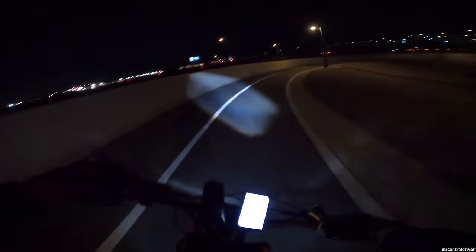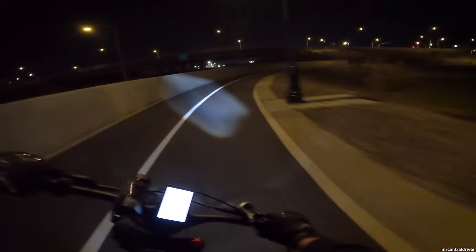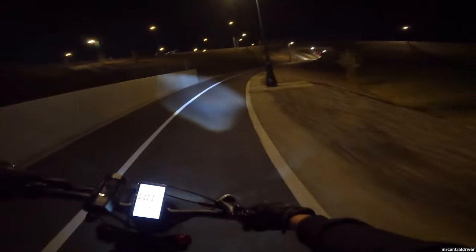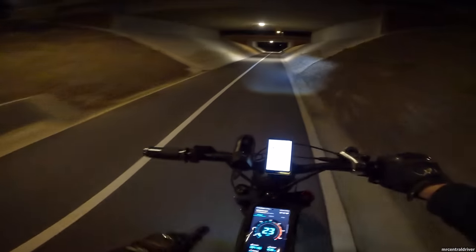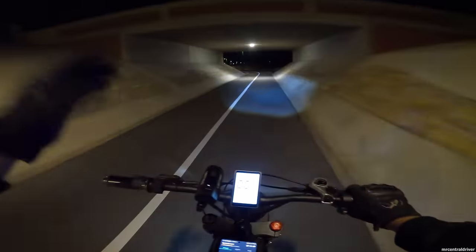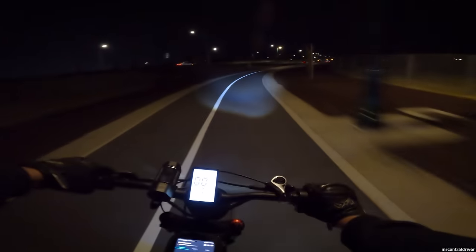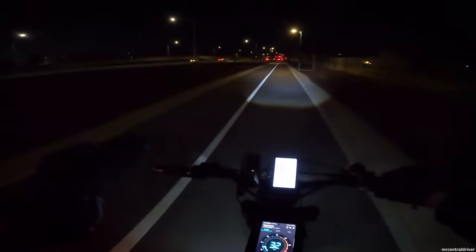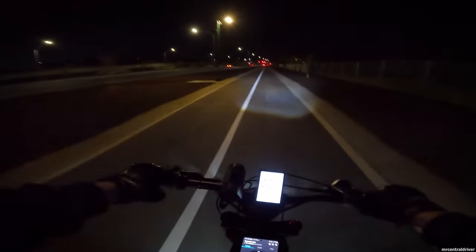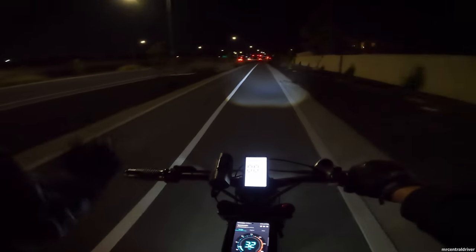You can see the lean angle I'm getting on this bike. The pedals actually felt like they were going to scrape but they're actually pretty high off the ground. They do need to be lower though — and we already talked about them thinking of shortening the cranks. Personally I think the better fix would be to redesign the frame so the crank position is just a little lower, keeping the same crank length, because once you shorten the cranks they rotate much faster through a shorter arc.